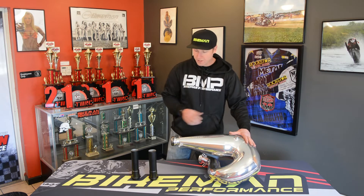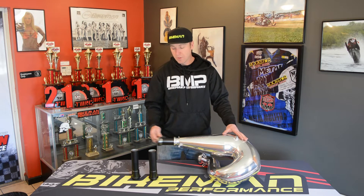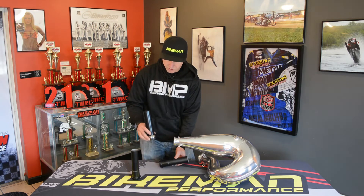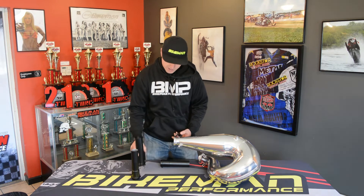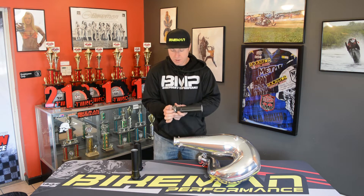The pressure in this chamber is very important to do that. As you go up in elevation, we lose air pressure, and when we lose air pressure, we also lose pipe pressure. So one neat thing that we did here on the Skidoo pipe to adapt for that is we made a removable stinger that can get smaller and trap more pressure as we go up in elevation.